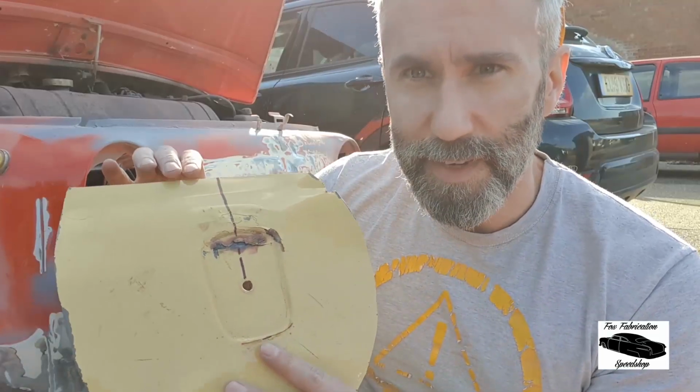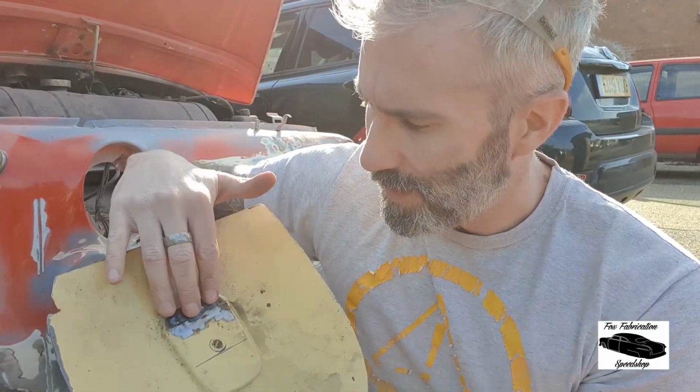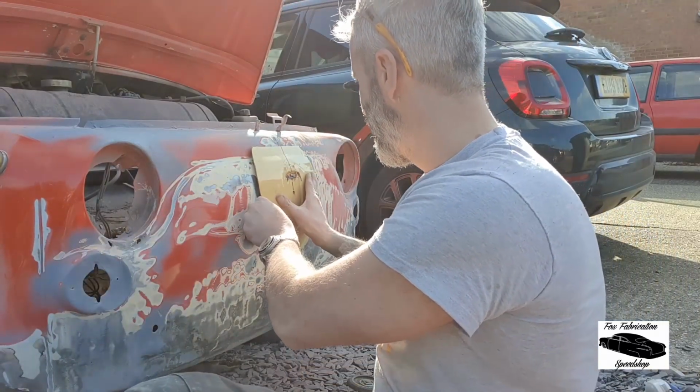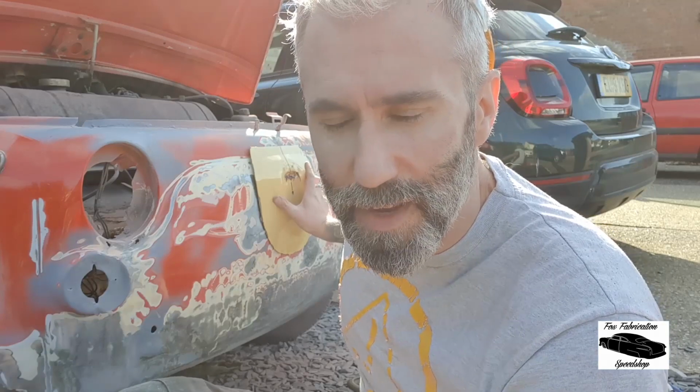So what we've done is we've straightened this out a little bit. We've taken the support bracket off the back, which means what we can do is align this to the panel in the correct place, tech screw it in as before, and then mark off around the outside where we can trim the two parts at the same time, giving a nice flush face for welding together.